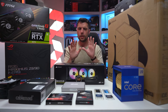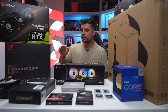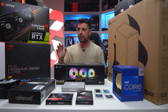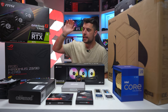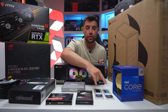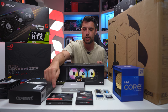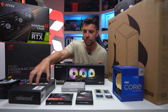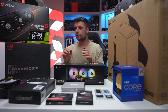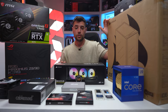We've got the RTX 3070 because we couldn't get the 3090 we actually wanted. Don't be put off — the 3070 is still absolutely fantastic and will do really well with the 12900K. With the amount spent on the motherboard, cooler, and CPU, the 3090 would be a better pairing at this price point. We've also got 32 gigs of Crucial DDR5 memory, a 980 Pro for the OS, a 2TB Samsung 860 Pro SSD, cable mod extensions, and three extra ML120 RGB fans. We may do a push-pull in the 4000X with the 360 AIO at the front.